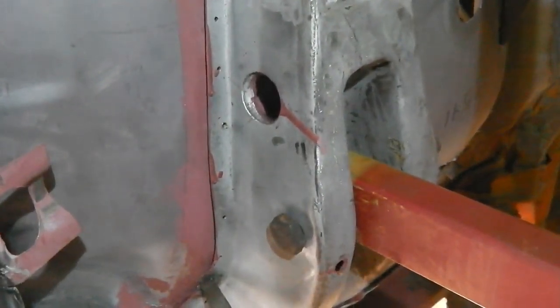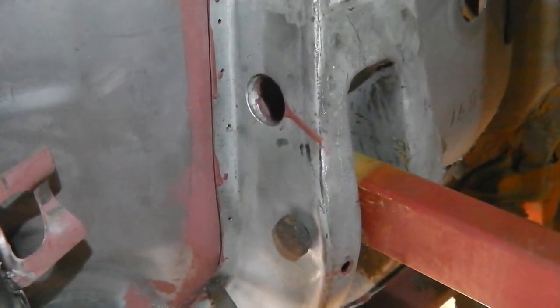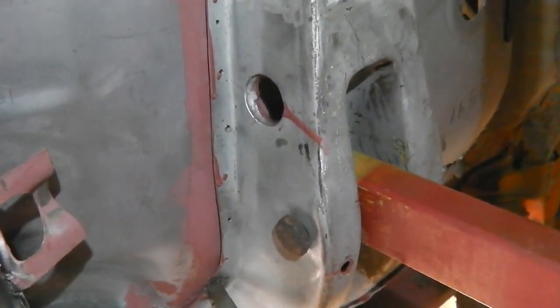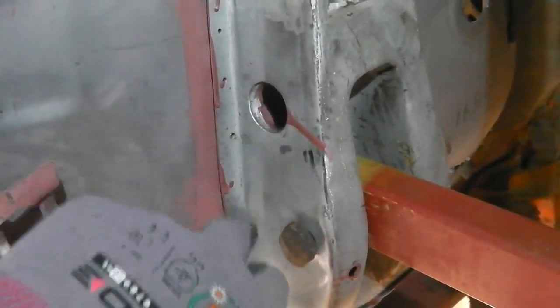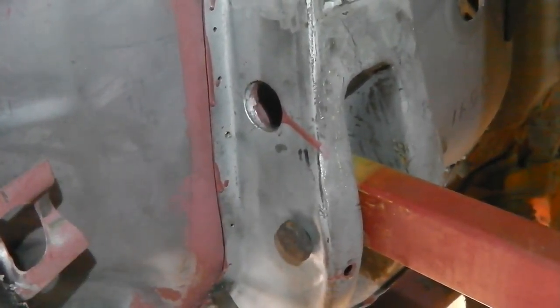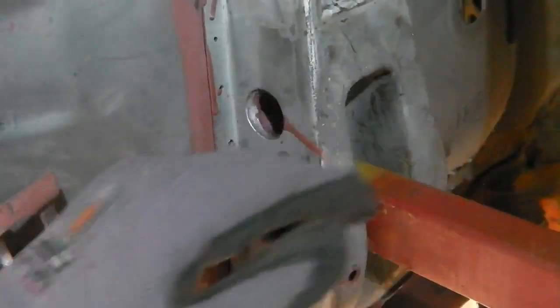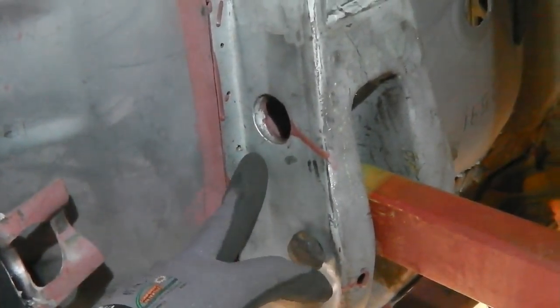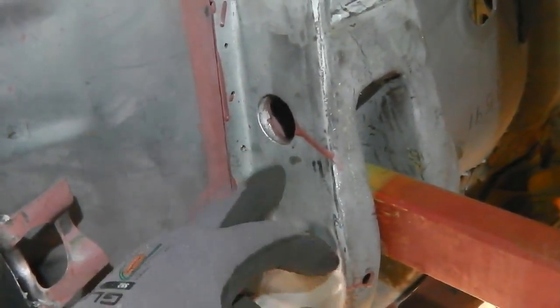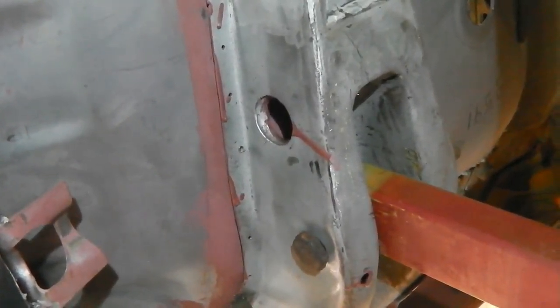Like that. We do them all the way along, and that'll give us holes inside the floor pan, which is where we then can put either tech screws or we use a spot weld drill bit cutter to then make the full hole for the plug weld to go in. So they're just very handy to do it. I'll do that both sides, and it just means you're not guessing. And then because it's the same hole, at the same time you fill it with a welder when you do the spot weld. And they're in exactly the same spacing, the same amount.